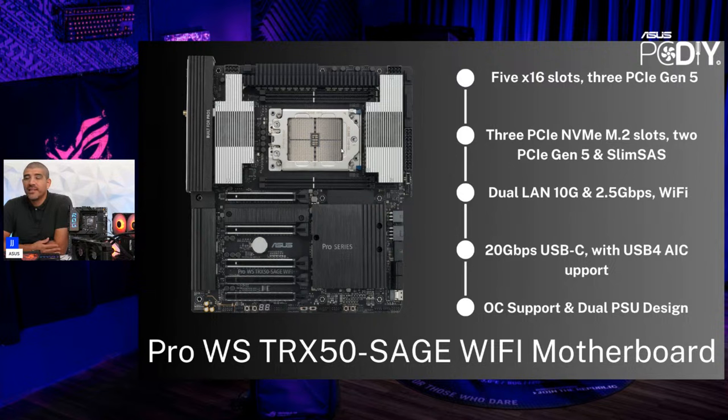As you start to get to more demanding multi-threaded workloads, you could be breaking 200 watts. In these types of platforms, you could easily be over 300 watts when overclocking. So we have designed the motherboards to fully allow for overclocking. You can overclock the CPU and the DRAM, although keep in mind that it is not the same standard DRAM that comes on traditional platforms.